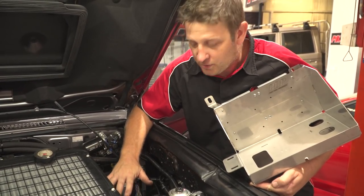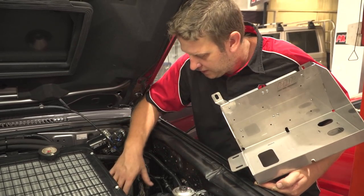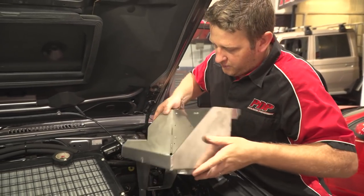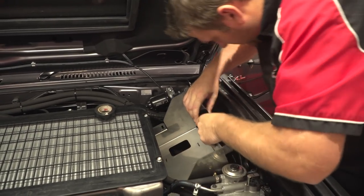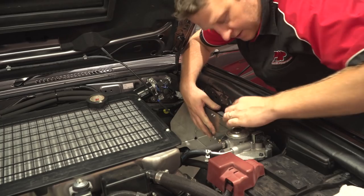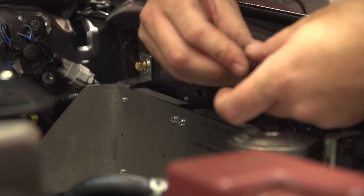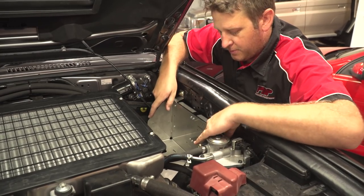This is where a little bit of juggling with the wiring is needed - just make sure everything is relaxed where it wants to sit, not stressing any wiring or pushing on anything. You want it to just slip into place. The first time around it might not go in straight, but you'll see where things need to mount. What you're looking for is these two mounting points on the side. Then we'll get the two shorter M8 bolts and bolt them into the guard, just starting them loosely.